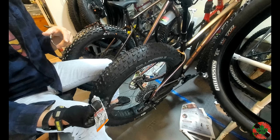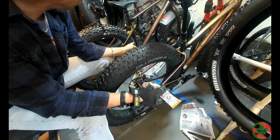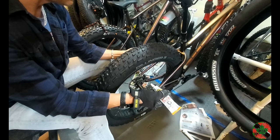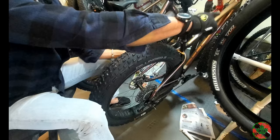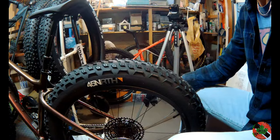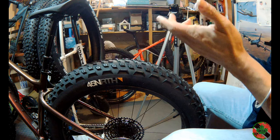I'm not having riding issues — my grip is great. My issue right now is just finding the right tire pressure. I rode at 3 psi on Sunday and it just about killed me, so I'm going to take it up to about 8 psi to see if that makes a difference — I'm wasting too much energy on a soft tire. Over here we have a set of the original Maxxis Colossus tires, which run a lot better at low psi — down to 3 psi and they feel great. They probably have a slightly tougher sidewall.